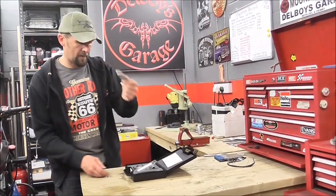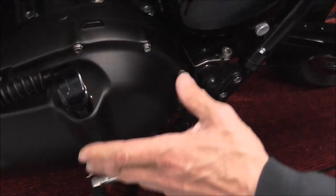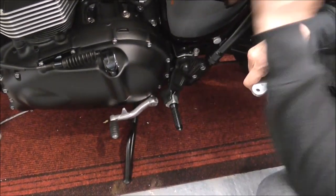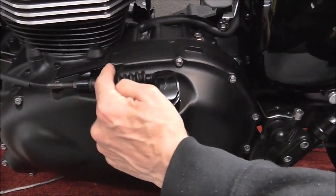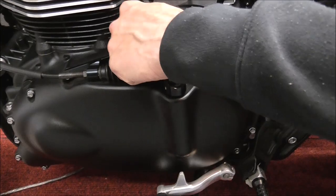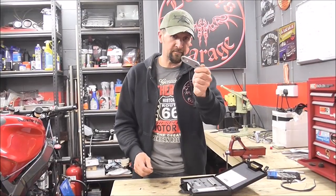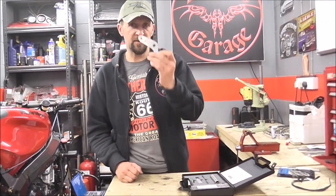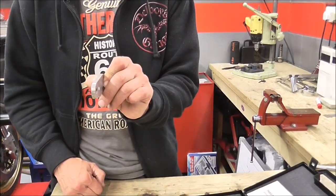I'm going to use this little bit of aluminium to represent the engine casing. These are really common ones — these strip all the time. Because you get this bracket on there, do it up, think it's not quite tight enough, want it a bit tighter. These are a common one because the bracket has to be connected securely, so people go leaning on these bolts and the thread inside the engine just gets stripped out. I'm going to use this straight piece of aluminium — six mil thick, standard stuff, from an old bracket. That's like an engine casing thickness.